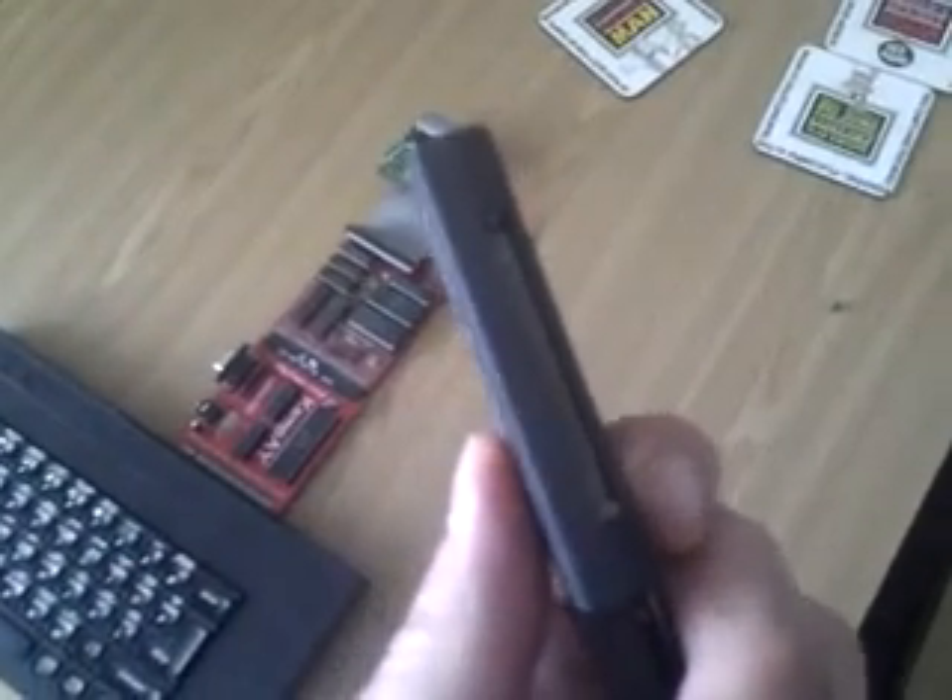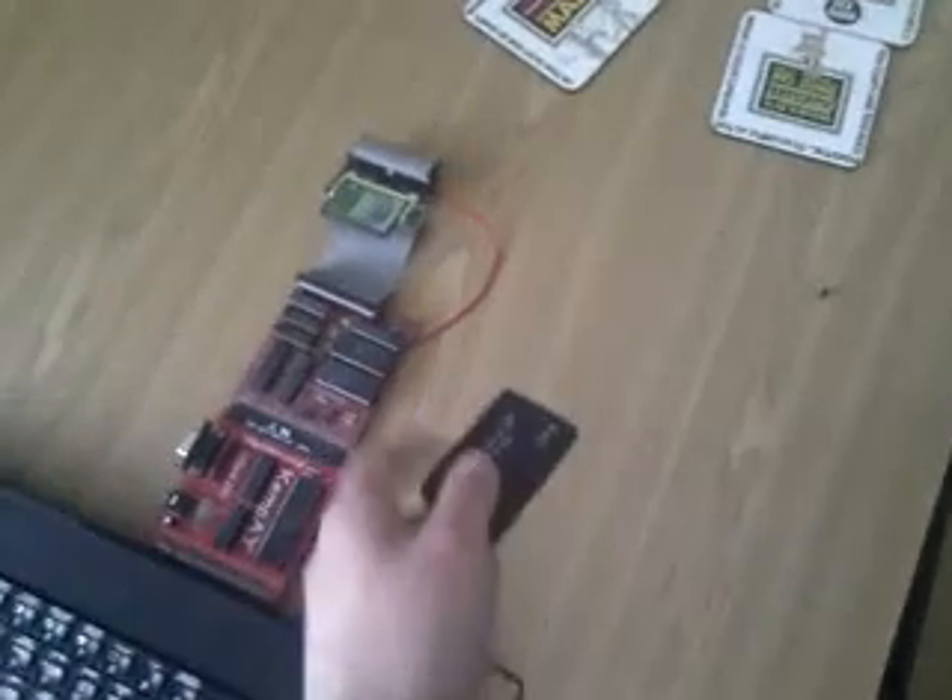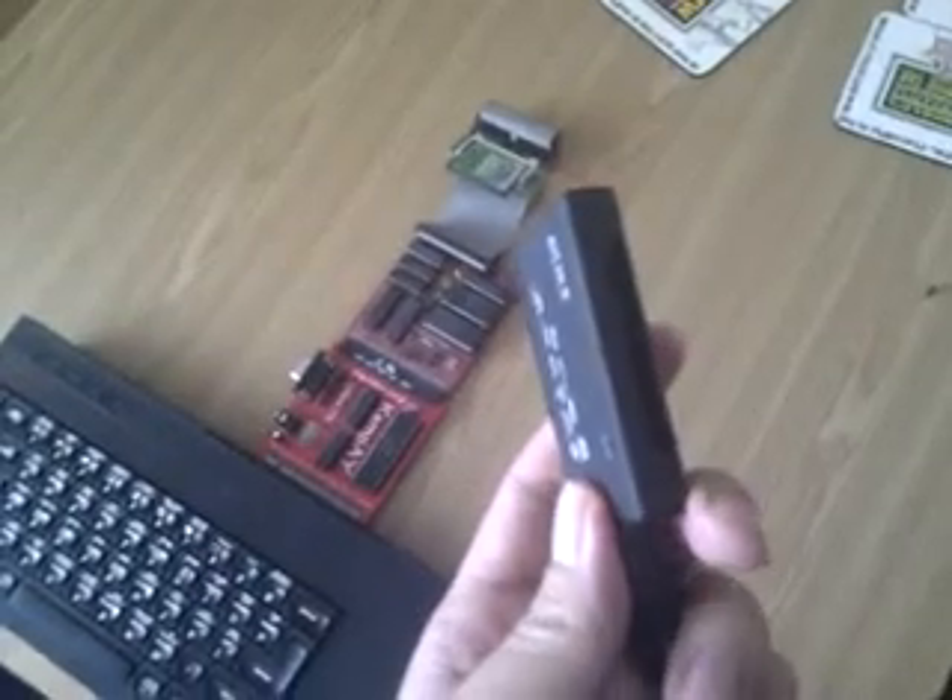It depends what firmware you're running on the Divide. The easiest one is probably FATWARE — just a case of pressing a button on the Divide 57C, and up pops a little file selector where you choose your games. It reads TAP, Z80, and Snapshot files at the moment. That's how you get all your Spectrum emulator games onto the Compact Flash card.